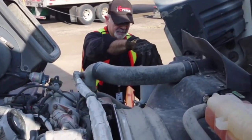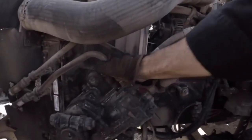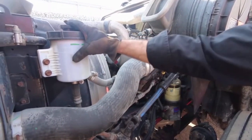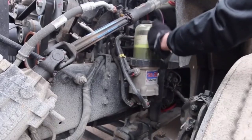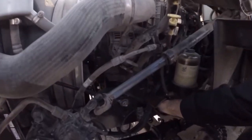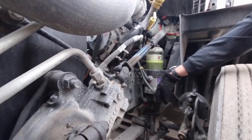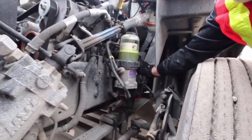You're looking at all the different engine components. Steering cannot have more than 10% play. You're checking all the fluid levels — the power steering, the engine oil. You're checking your fuel filter, making sure it's flowing freely and there's no blockage. You're looking at all the wiring, making sure that none are frayed or broken. You're checking the frame — make sure there's no unmanufactured holes. Check the shock towers to make sure they're solid, not leaking, no marks, no damage.